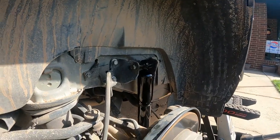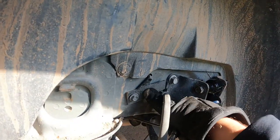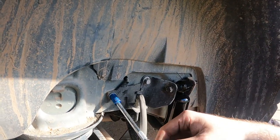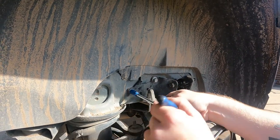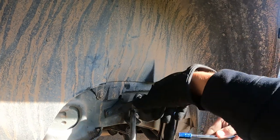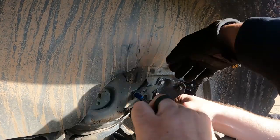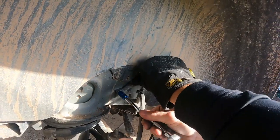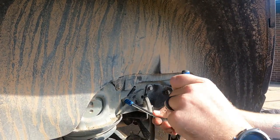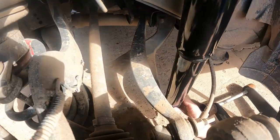It is getting a little toasty out here, but now that the top bolt is back in, we can go ahead and put our brake bracket back in there. You want to make sure that the top clip gets into that hole — it came out, but there we go, now it's in there and tight. Boom. Now the last thing is that bottom bolt on the shock itself.